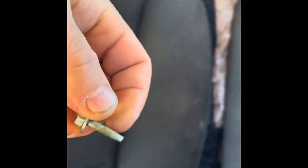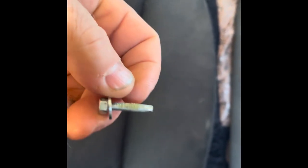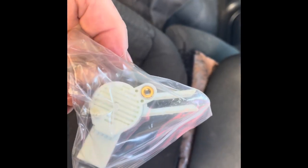It's a seven millimeter bolt that is way too long — due to the fact that it only goes in to the part that's yellow. It's really hard to get to, you can't get your hand in there or nothing. Now I'll put the other one in, which is right here in the bag — a nice O'Reilly's part. You just gotta line up that bolt hole and line up the shaft from the brake pedal.